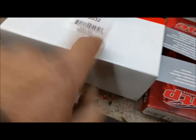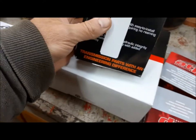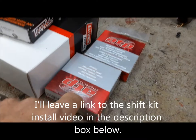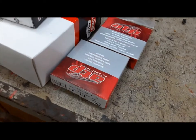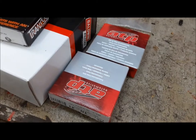Here's our stuff that we're going to need for this job. We've got a service kit — a gasket and filter. We've got a shift kit we're going to be putting in; I'll show you how to do that and explain what it does. And these are our bushings for the linkage. I've also got a new selector seal and a kickdown shaft seal, because this transmission leaks like a bugger. We've got to fix that.